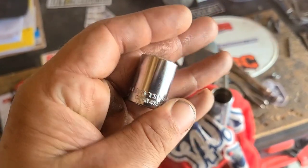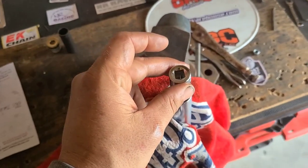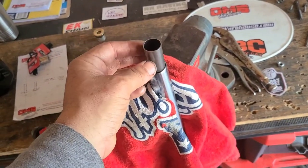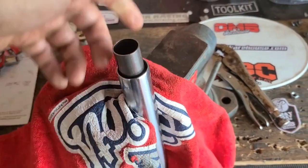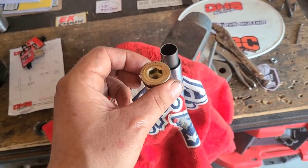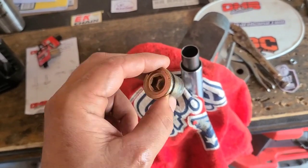The 5/8 sockets are just over an inch — about an inch and an eighth, actually. I'm going to be dropping these in on top of the spring. Next, we're going to drop in the factory spacer. There's that preload I was telling you about — it's going to be a little bit harder to push down. I'm going to clean this off real good, lower it down, and use my palm to hold steady pressure and twist — keep that pressure, twist, get a few threads in there. Do not cross-thread this, don't strip it out.